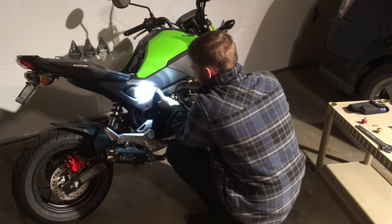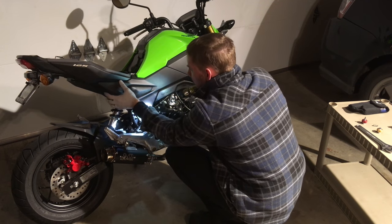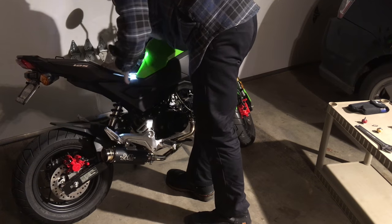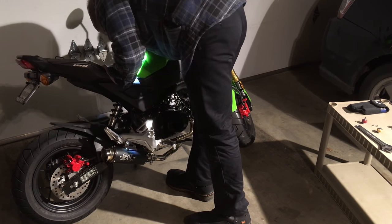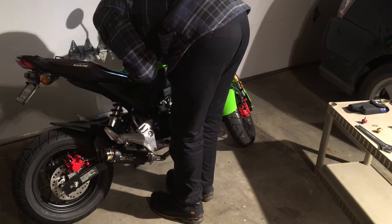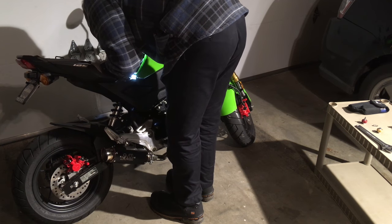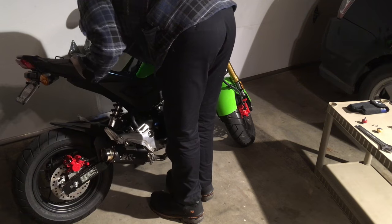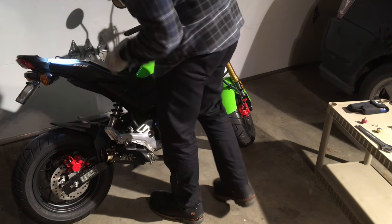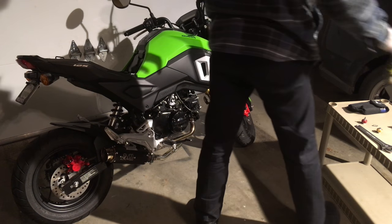If you over-tighten plastic with the screw, it has this property called creep, where the screw will cause the plastic to kind of deform and ooze, very slowly ooze away from the pressure point. If you've done any kind of 3D printing, this should be well familiar. If you screw into 3D prints, it's a really good idea to use a bolt and a brass insert.